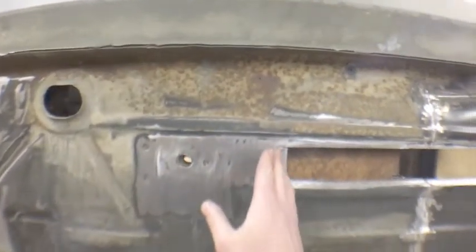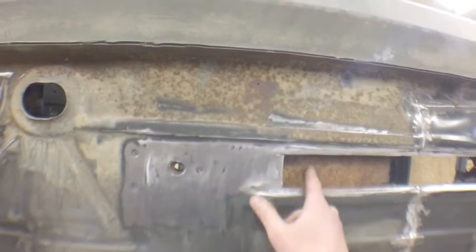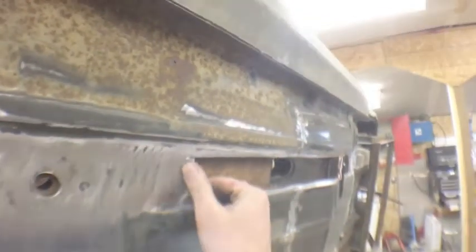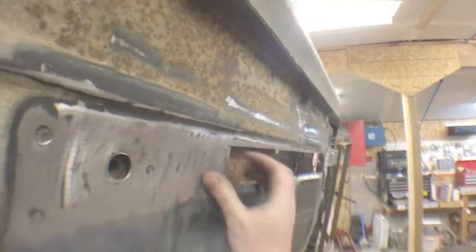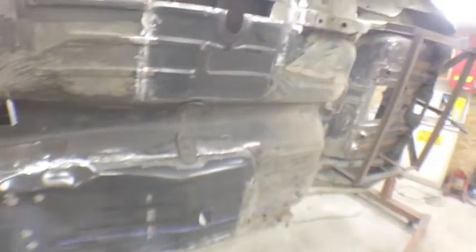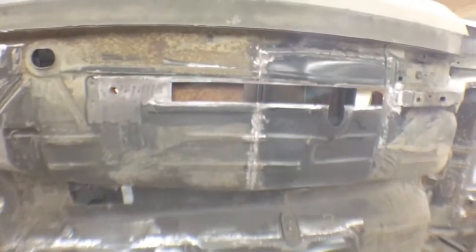You can see where I ended up stopping here. It's obviously going to be near impossible to get that welded from the inside without taking the seat pan out. I'm not going to do that. I'm actually going to seal it from the outside, which is probably not perfect, but I'll be able to get really close to it. And by how much undercoating and everything I'm going to have under here, it's going to be really solid and really sealed up. After these get welded in, I'll do the video on the rest of the undercoating process for this car and clean it all the rest of the way up. I'll get the other one cut out and I'll probably show some time-lapse welding coming in and the finished product.